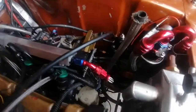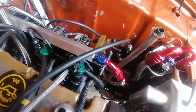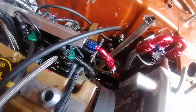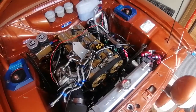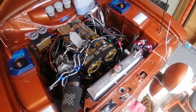We've done the dry tissue test underneath the fuel pressure regulator. First time I've used the Duke. The only thing I didn't like about the Duke was the fuel pressure gauge. Had the gauge in there, I got her running up to 3.5 bar, which is the standard regulator, but she can be mapped now to a different fuel pressure. But that gauge would not seal. It's alloy casing on the fuel pressure regulator, you don't want to do it up too tight. Even with a bit of PTFE tape, she was still leaking. But we've got there. I don't leave the gauge on. It's still on in my Cosworth at the minute, but that was because I've been adjusting my fuel pressure regulator because I had a bit of boost cut. But I'll be taking mine out as well.